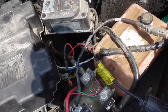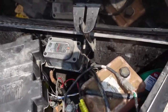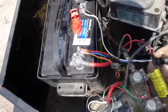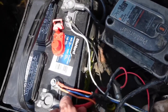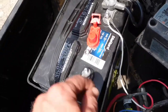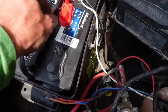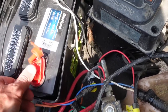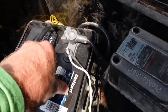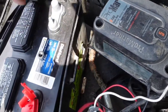So this is inside of the compartment on the dump trailer. This is where the reservoir for the hydraulic fluid is, and then the battery. So the first thing we're going to do is disconnect the battery. We've loosened everything up on this end. Disconnecting the battery — put the nut back on so we don't lose it. Quick identification of which one is positive and which one is negative. Disconnect the ground.